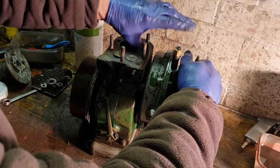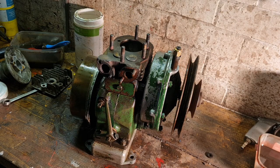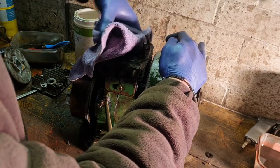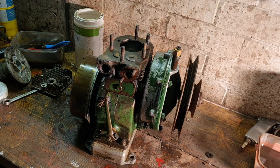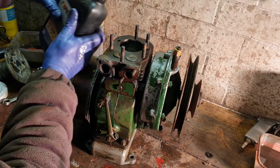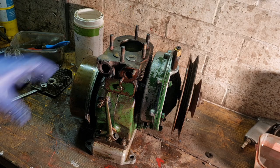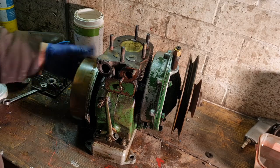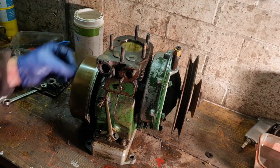Now, before we start turning this thing over left, right and centre, I'm going to get a brand new clean cloth and wipe the grit out of that cylinder if there's any, which there isn't really because I've kept the head on. I like to keep them a bit clean, and so we don't wash the bores. Yes, that is correct terminology. We can just shove a little bit of motor oil on top of that piston. That'll put a film over the bores, so when we're turning the engine over, it doesn't wash them. You don't want too much where it spills out everywhere, but enough where it just coats the cylinder. There you go. She's coated that cylinder, look. Absolutely marvellous.